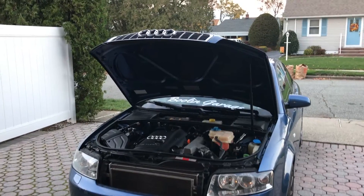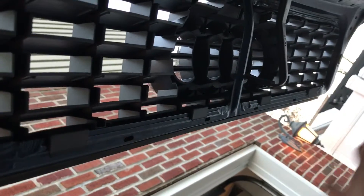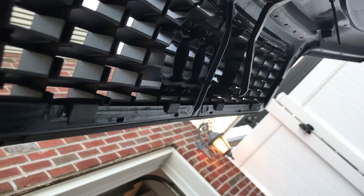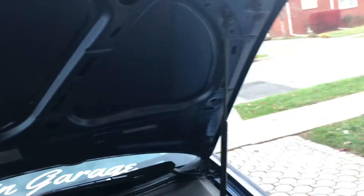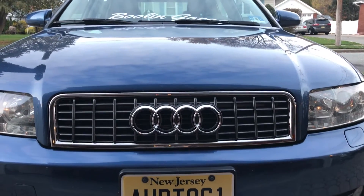As you can see by that shine, the new grill's in. Just a side note though: when you go back to install it, these four clips at the bottom — I'll point out one of them — be sure when you're putting the grill back on that these are slid underneath, attached to the hood, and not caught underneath here. What happened was the one all the way to the right was caught underneath the hood and it wouldn't snap — the last clip wouldn't snap in because it wasn't secured properly. That's it — quick and easy mod to your car that makes it look a little better. Let me drop the hood. Way better — what a difference it makes to the car when it's all done.